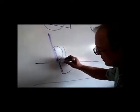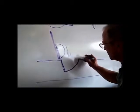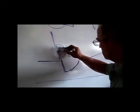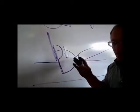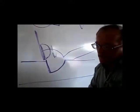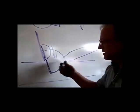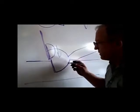Then when the groove is shaped correctly, what happens is the bit will go in here, and then when you put it in afterwards, it'll lock into position. And the more wobble you have, the less accurate your groove is. What you're looking for is at the most a 20-25 degree angle for maximum efficiency. So when you put it in the groove, you'll wiggle it back and forth like this. And again, we'll show you that in a few minutes.